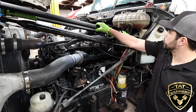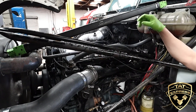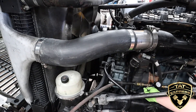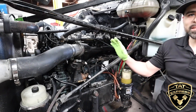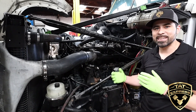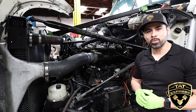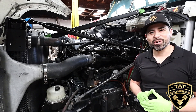Let me move this light so you can get a better view of the top. We'll go ahead and add air and see where we get a leak from. Okay, so you see the engine rotated there — that's not supposed to happen. The engine is not supposed to rotate. What that is telling us is the air is actually being leaked down into the cylinder. So if this cylinder is at its top, when we added air it pushed that cylinder down and made the engine rotate. We definitely have a leak — we're going to dig into this further. I'm going to pull these injectors to see what we find.